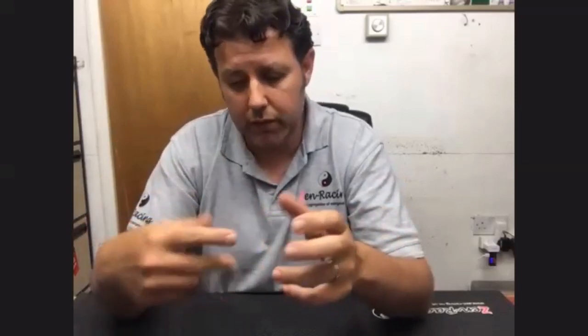We can move the motor in the pod a little bit forwards and backwards on gearing between pinion and spur. We can move it forwards and back a couple of millimeters, but generally the battery is what makes the biggest difference. The further forward you push the battery, generally, the easier and smoother the car is to drive, but you will gain more high-speed steering because you have more weight on the front tyre.